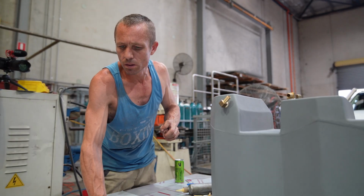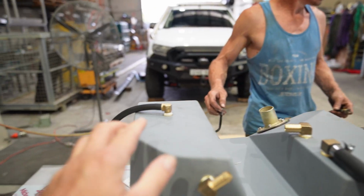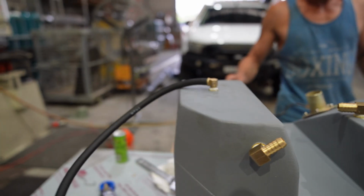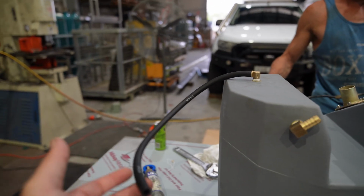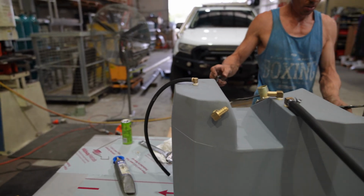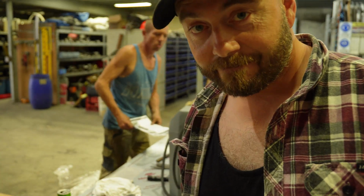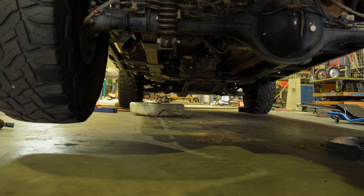You attach a hose onto this one, so I guess it'll be a 1/2 inch hose in the bag somewhere, hopefully. So the discriminator valve is fitted in, and they've said put this 6mm hose on and whack a hose clamp on there shortly, and it'll connect somewhere up in the car. We're going not too bad, Johnny boy. That looks to be it for the fittings, so next phase is get it back under the car.